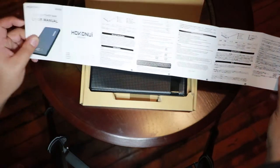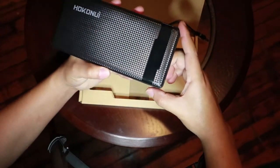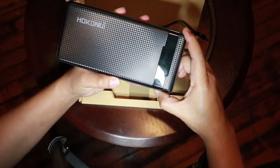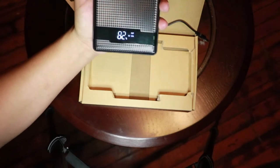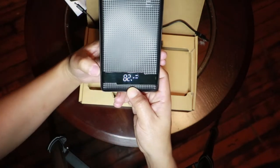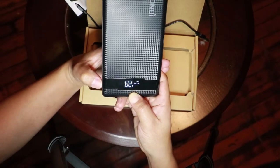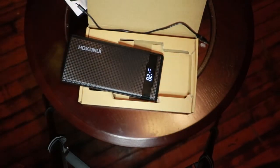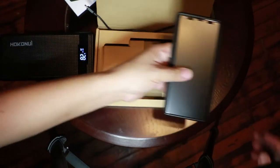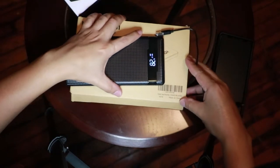One thing I kind of like is the picture option because these days you want to have your phone or camera ready to use. I was reading the manual, and what I found is that when you plug two devices in — one on the QC 3.0 quick charge port and another on a regular USB — the quick charge is not going to push full power; it's actually going to charge your device at regular speed. So if you want to take full advantage of the QC 3.0 quick charger, you should charge just that one device by itself.